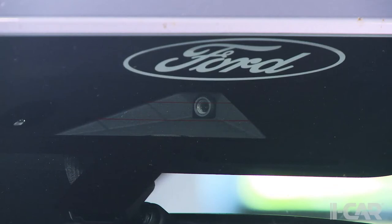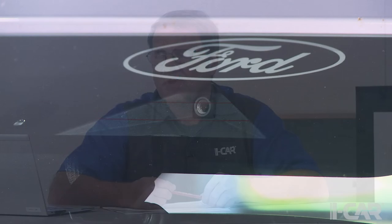Now, IPMA, which is the windshield mounted camera we're looking at right here, is very similar again to the sibling vehicles in the lineup. It uses a lot of the same architecture for the ADAS systems, where the camera is a camera reporting to the IPMA control module, which all of the sensor technologies report to on this vehicle, and the fusion of data happens for the operation of those systems.